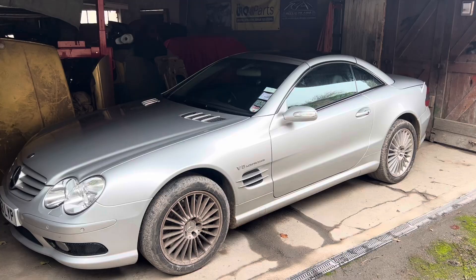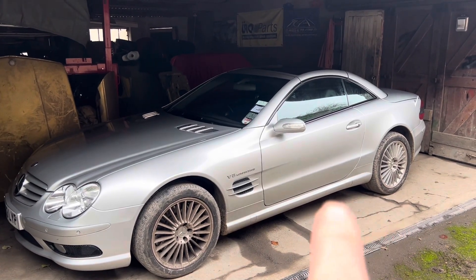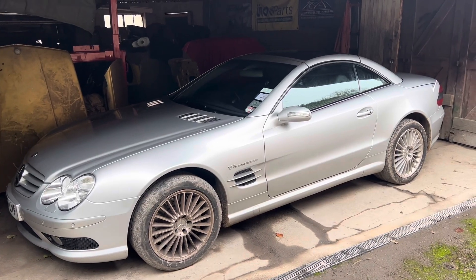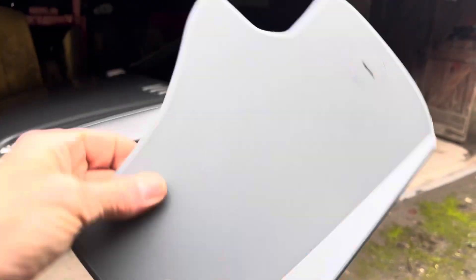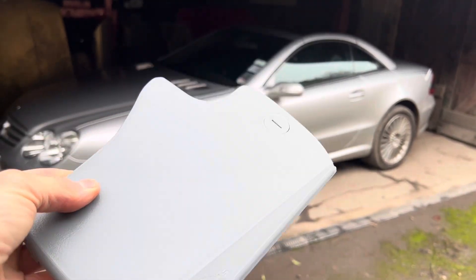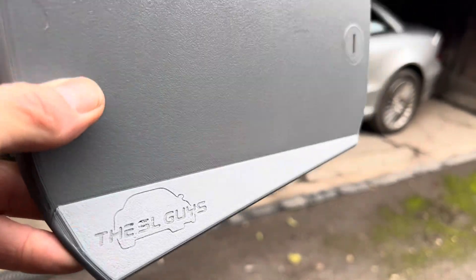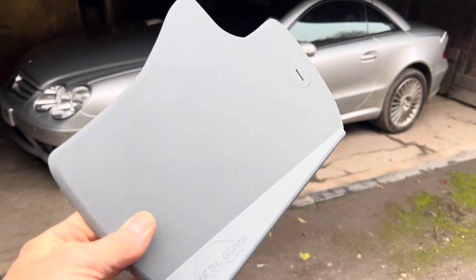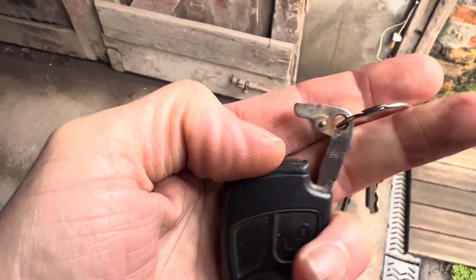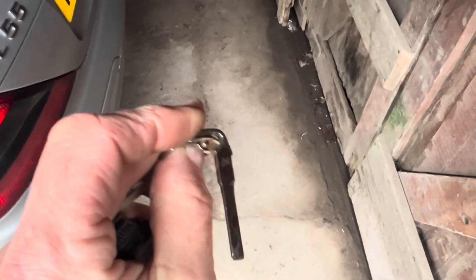You don't have to cut a hole in the boot lining to gain access to the battery control module — you can take out all the rear trim, and I've done a very detailed video on how to do that with a link in the description — but even if you know what you're doing it will take at least 20 minutes and the chance of breaking plastic trim is extremely high. An inspection hatch will allow you to easily and periodically inspect your BCM for signs of burning. If there's any sign of burning, the same guys have produced a replacement for the battery control module — a pretty much plug-and-play unit — and I'll be doing a separate video on fitting that. The first thing I'm going to do is slide back this lever, take out the blade key, and make sure it fits the boot lock.